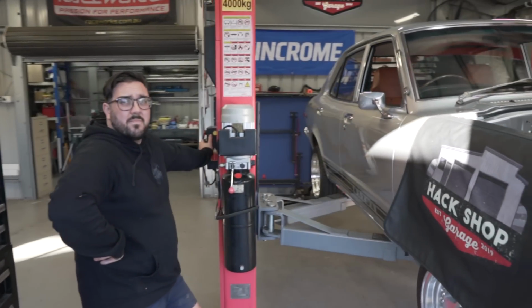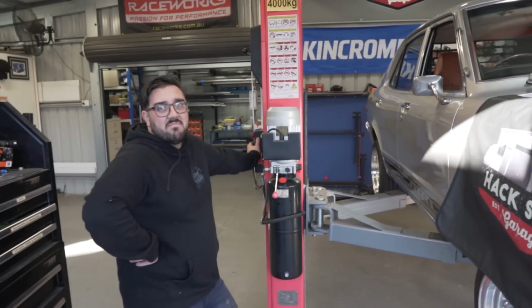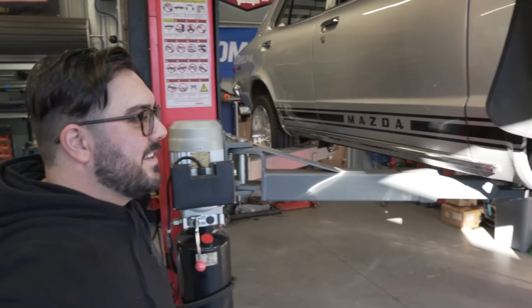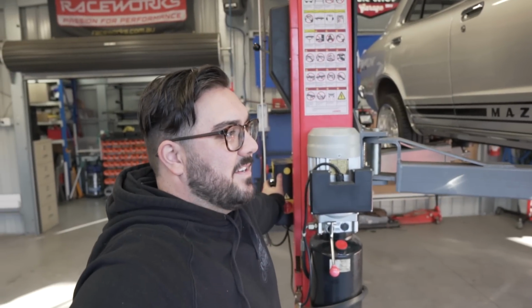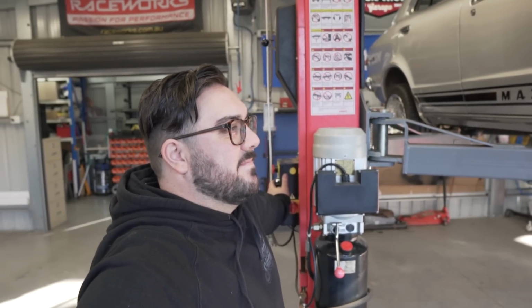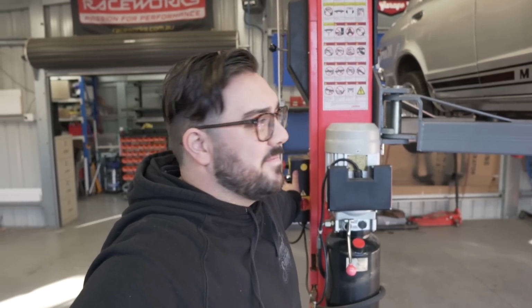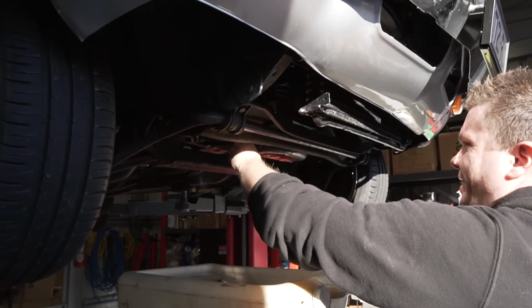Yeah. Alright, so the gearbox sounds quiet. I mean, we only just spun it as much as I was willing to do, but everything shifted in. Now we're going to dump the oil. We just got it warmed up a little bit and we'll dump the oil, do an oil change. Roll it out, put the console back in, and that's it, done. Go for a spin. This car's done. Oh, the bolt's nice and warm.